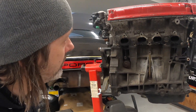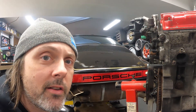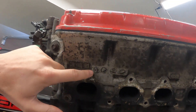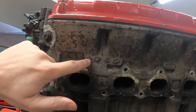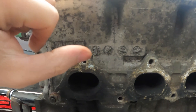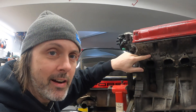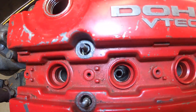What we should be able to do is look at the date code on the head to figure that out. Right here you're going to see these little circular casting marks — these are rotated and changed out as these heads were produced. The first one right here reads '66,' but if you flip that around that's actually a '99.' So this must be from a '99 Civic Si.